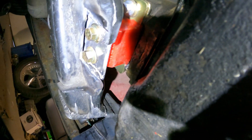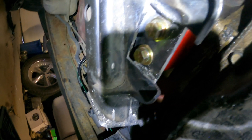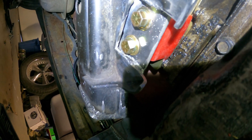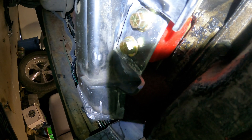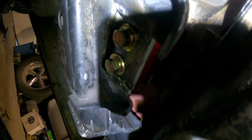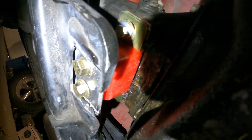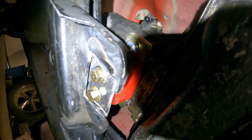This is what I ended up having to do to get this transmission mount to work. I had to put a plate on it, cut the original crossmember — it just needed to be raised just a little bit. So I cut it, stacked it, and then welded it. And then I was able to bolt directly to the mount, and that worked out really good.